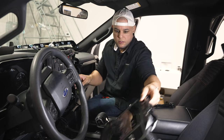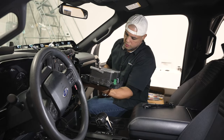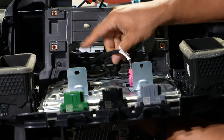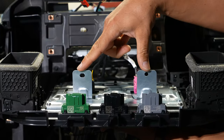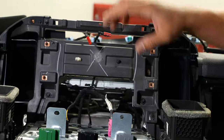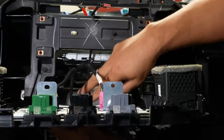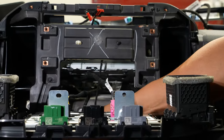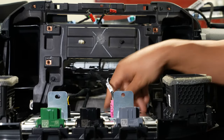Now we're ready for our screen. On the back side you'll see the two connectors where you're going to attach the pink line and the power line. When we slide this back in, we're going to have to put those two internal 7mm screws back here. Before we set it up in there, make sure to plug in all of our connectors that we removed earlier, except for that single one that's going to be dropped down for our volume control — that line runs down to the new climate control area where it plugs in so we have volume control.